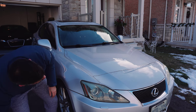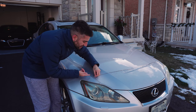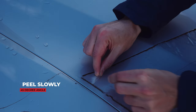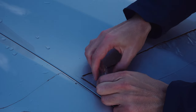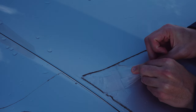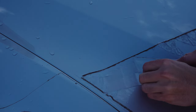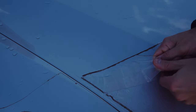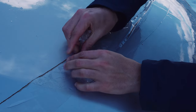I'm going to try to peel it using my fingernail first to see if it'll come out — and it is. I'll bring in the camera so you can see this. You can see where my finger was coming out at the first mark, and the second mark — it just came off right at the score line. Now we're just peeling this back slowly. Ideally peel at a 45-degree angle and do it slowly. You do not want to rip the paint — depending on how old the paint protection film is, you could potentially peel the paint along with the clear coat. Just peeling it off slowly; it's getting a little harder, so I might need some more hot water soon.